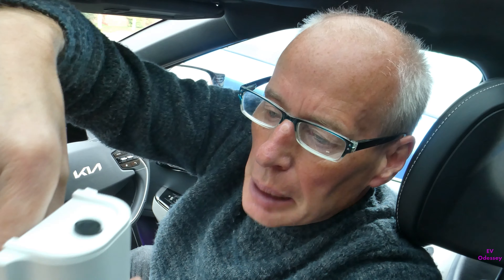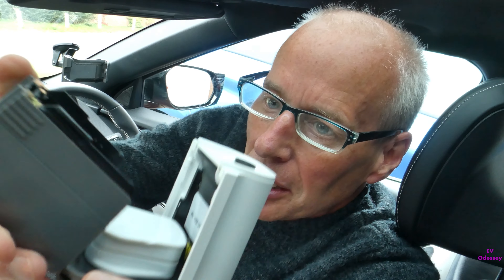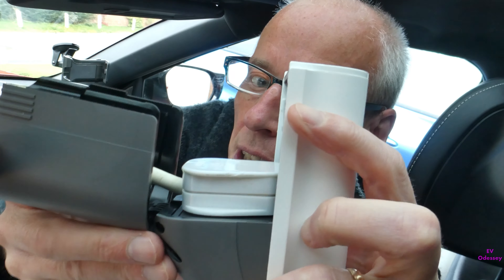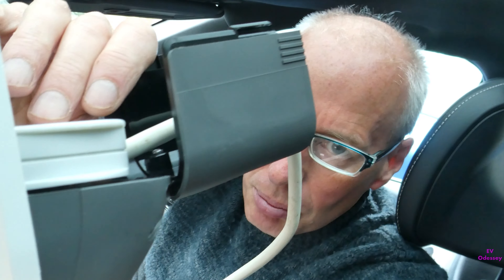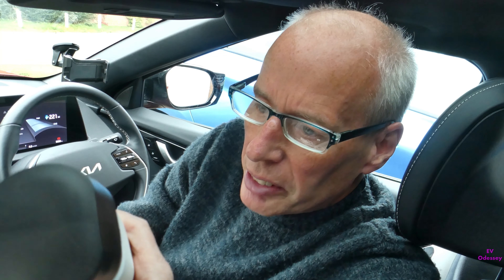The other problem is the UK power plug isn't really a good fit for this kind of design. The cable comes out through the bottom, and when you shut it, it puts a strain on the cable which eventually ends up with the insulation coming apart. When you close the end it pulls the plug out gradually — these are made for continental adapters, not really for a UK connector. You can see it's already prised the 13 amp plug slightly out.